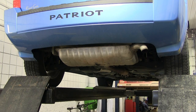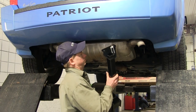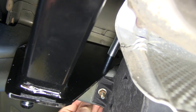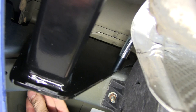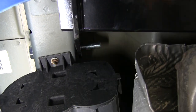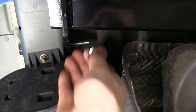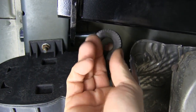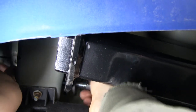At this point we're going to go ahead and install the hitch. We'll sneak the passenger side up over the muffler and let it rest on top of the tailpipe while we push the driver's side up and push our bolts through. Now we'll install our hardware. On the bolt going closer to the bumper, that will get the lock washer and nut. The bolt going towards the front will get the conical tooth washer, and the teeth on the washer need to go towards the hitch.